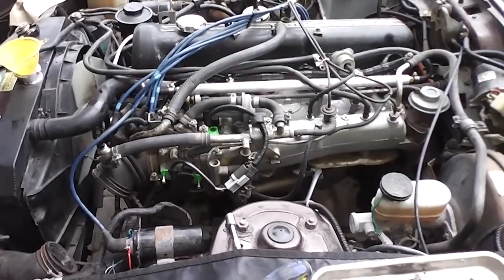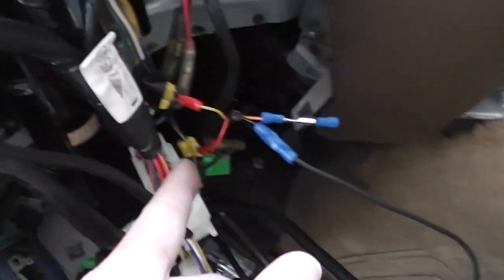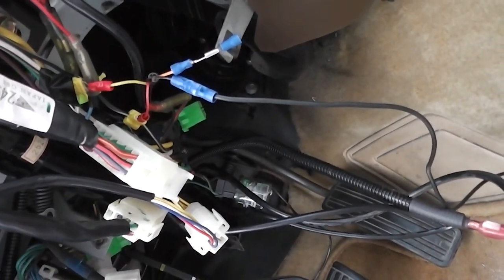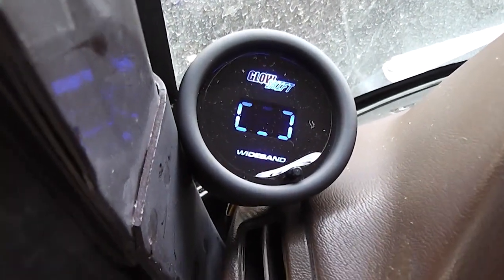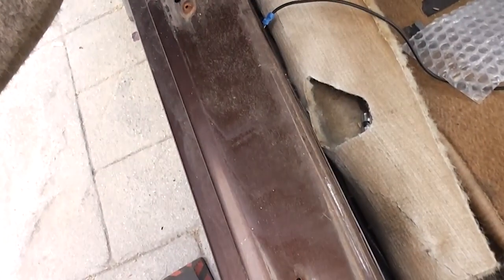I'll plug in the laptop and see what kind of tune we've got. I've taken the main power leads and wired them into the existing ignition harness — one for ignition on, one for constant power, and a ground. There's also one for the headlight harness, which creates a dimming effect on the gauge so it doesn't blind you at night. When I turn it on, it powers up. It goes through a 30-second self-check process before giving live readings. It works — I just have to figure out where to put all the wiring.